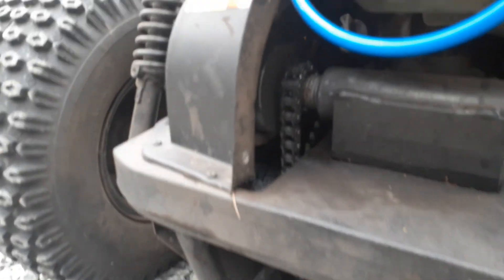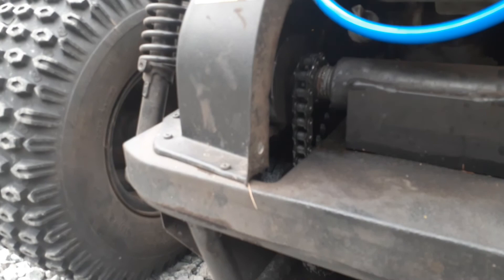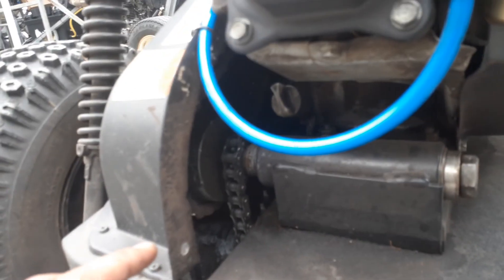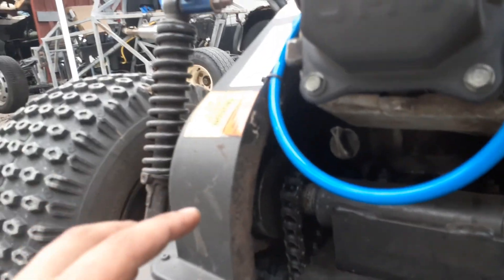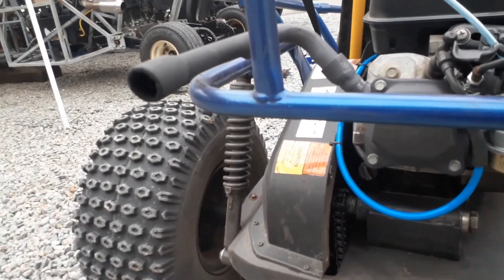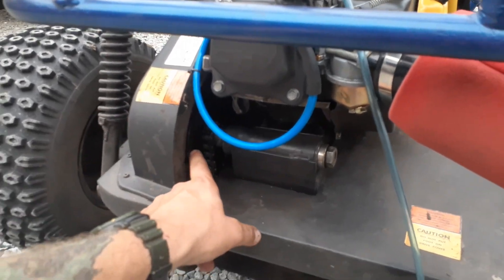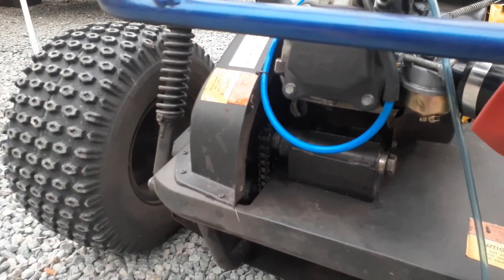I know a lot of people just go right to the rear end and you'd probably get some more speed that way. But I want to be able to go in the woods and climb up hills and such. With the slotted shaft and the jack shaft and two sprockets, it really works well. If I wanted to go faster, I'd change out this gear to something smaller, but then I'd lose on the lower end.